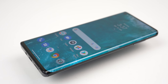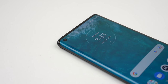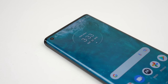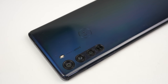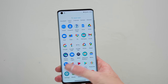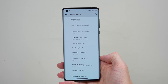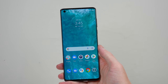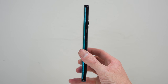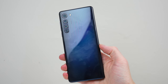And we're done. This is the Motorola Edge 5G. For a phone that's about 50% glass, that display replacement process was quite involved. Ideally you would replace the display alongside the frame, skipping out on having to unstick the old screen. But if you can't find the whole assembly, you'll be stuck replacing the display only, as I did here. After the repair, the phone is once again back in a fully functional state. As good looking as that display is, I'd definitely carry this phone in a case to protect the glass edges — after all, you wouldn't want to do this repair twice.